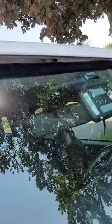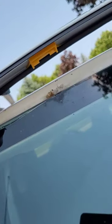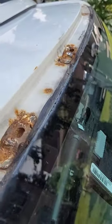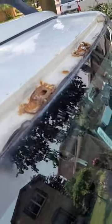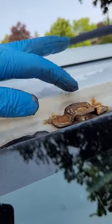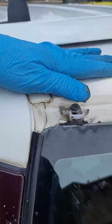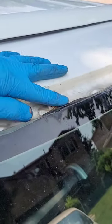I had a quick look at it and the two clips do line up. We'll get this piece out. These have rusted pretty bad and they're bent because the last person who did the windshield just pried them up. I'm going to hammer these out, try to get them as flat as I can, use a wrench, and then put some trim clad paint on it to stop the rust around these holes and clean it up a bit.